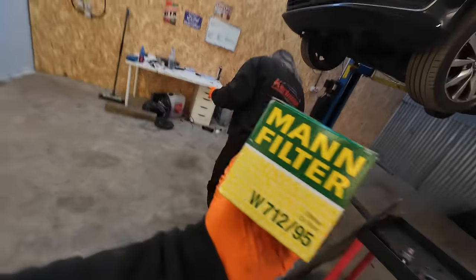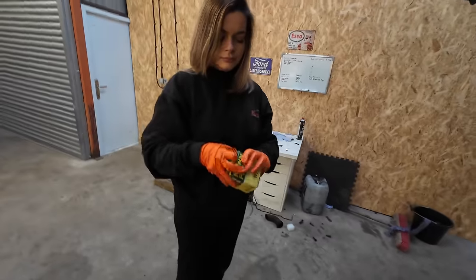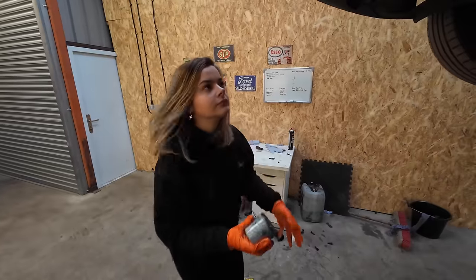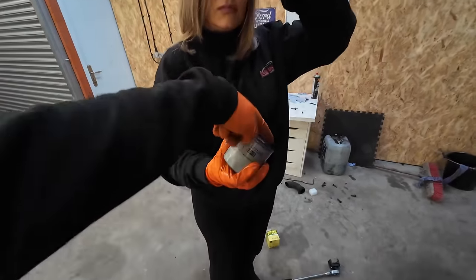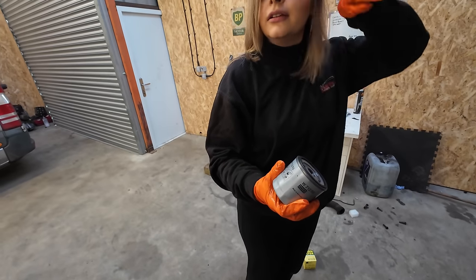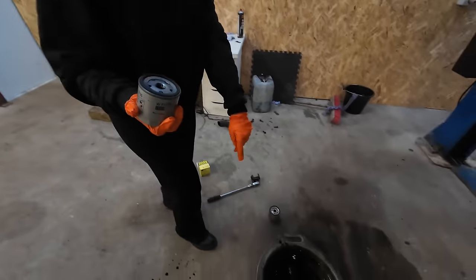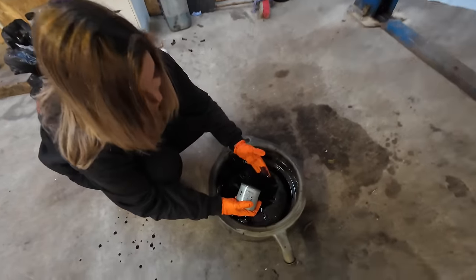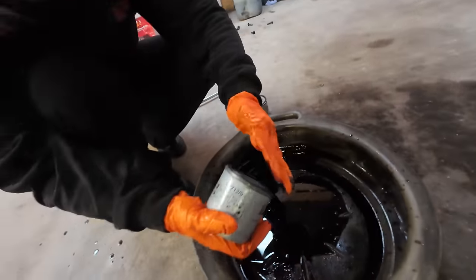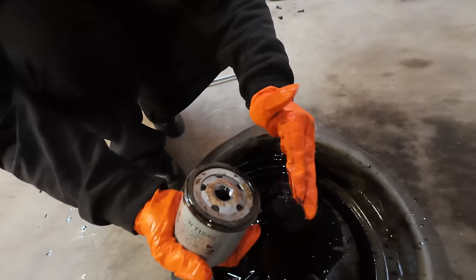Right, so we've got a new filter to go on. Before we put that on, we've just got to smear a little bit of oil around this rubber seal. You didn't need that much, but that's fine. Just smother it, that's it. Probably a bit much, but...